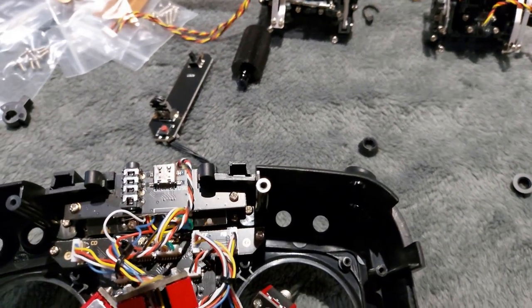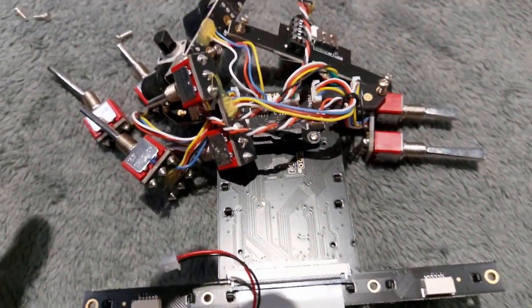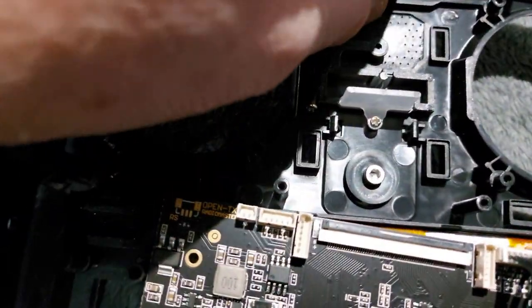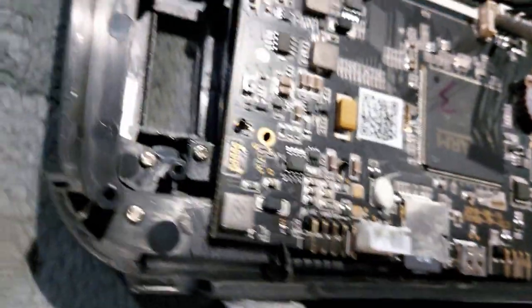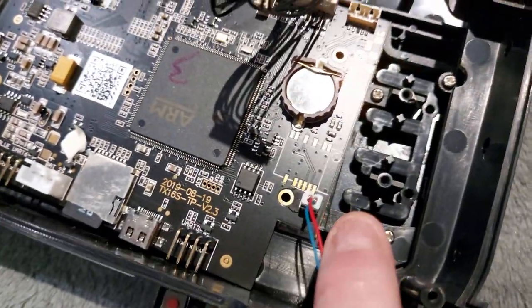I'm about 12 minutes in. That probably looks a little bit scary, but that is the entire centre unit — it all goes in there. Leave it all in one piece as much as you can. You need to pull these connectors out — there's one here and one here as well — and put those in the new panel. Now all I'm left with is my screen and my board. There were two screws on the bottom holding the screen in, plus one more, and the screen comes out. I wasn't going to film that part as I wasn't sure how it was done.